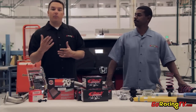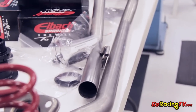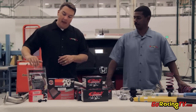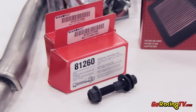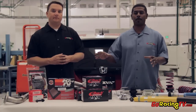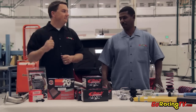This also has parts to make the engine breathe a little better. We have a K&N air filter, as well as a bolt-on straight-line exhaust to get the air out of the engine. We also have a steel braided brake line to help the car slow. And to make it go through the corners a little better, we have some camber bolts to get a little bit of negative camber. So what we're going to do now is actually install the brake lines and the camber bolts in this Honda Fit sitting behind us. Let's get to work.